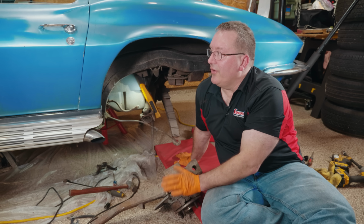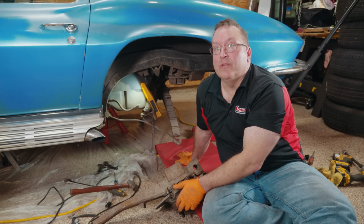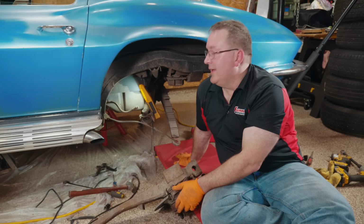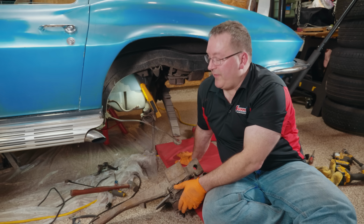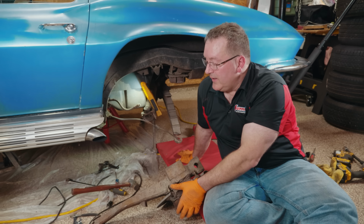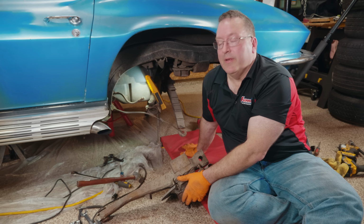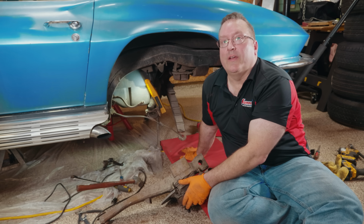Technically it's not, but when you're on the garage floor, and basically like a lot of our customers are going to be doing, using the tools that you have, like a Sawzall, wrenches, sockets, etc., you do the best with what you can. We finally did slay the dragon, so to speak. We got the trailing arms out. Next step is going to be powder coat, push all new bushings in, new bearings, freshen up the brakes, all that good stuff.